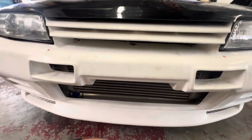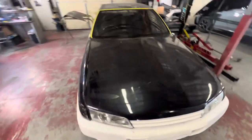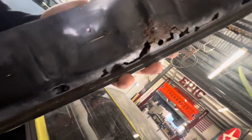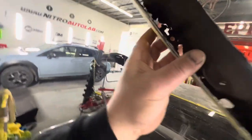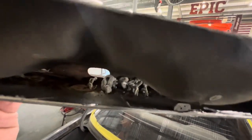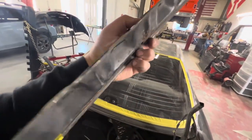We got him the style he wants — it looks awesome. Everything's pretty much fitted. We do have to weld up a couple patches on the inside of the hood where we cut out the inner structure so it would clear the grille. You can see the light through there — that's all rust holes on the bottom side of his hood. This is the section that we cut off. You can see all that gray swirly stuff in there — that is bondo that they filled in on the top section of the hood at one point, last time they painted it. The bondo was just falling through the holes and they just left it. Super good idea that we went ahead and just cut that off.